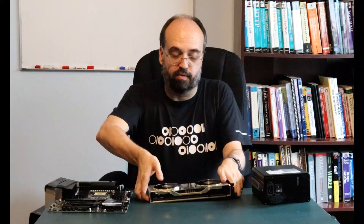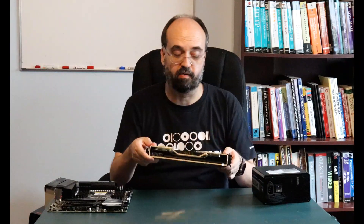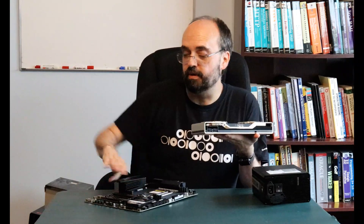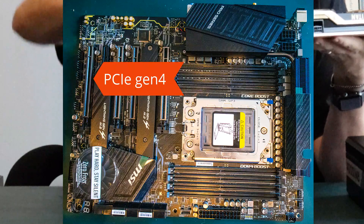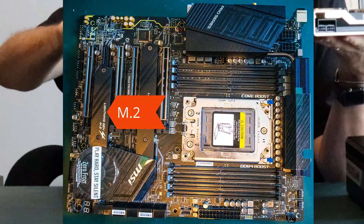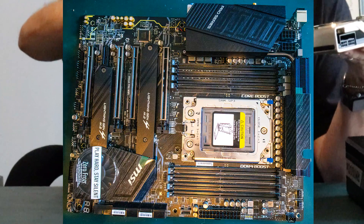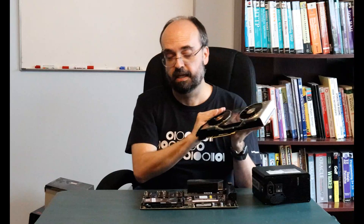Really what goes into this: you have to connect it to your motherboard. It has the SLI connector as well, which I will not be using — I'll be doing this in a single GPU configuration. You'll want to put it into the PCIe slot on your motherboard. Since it's double-width, you can see there are M.2 slots, which is essentially where I'll put the SSD. M.2 is the stick-shaped hard drive that mounts very close to the motherboard, and that's the type I'll be using.